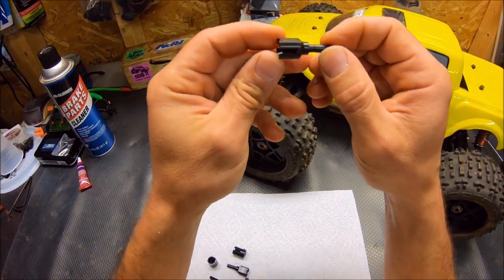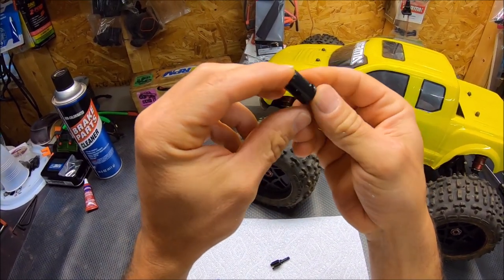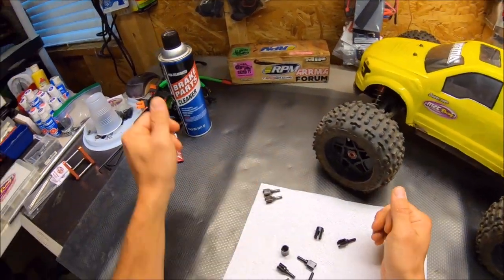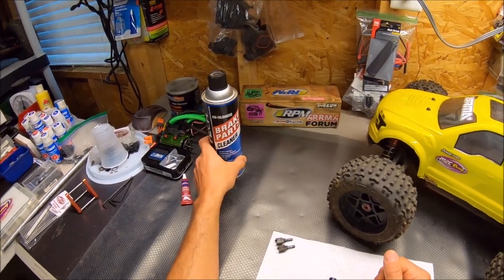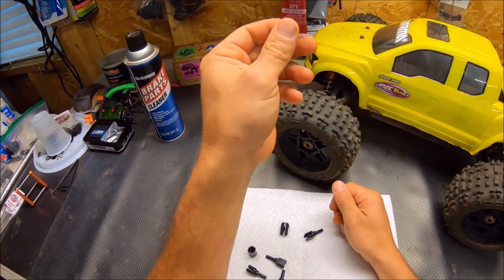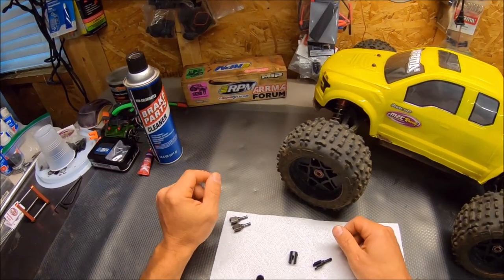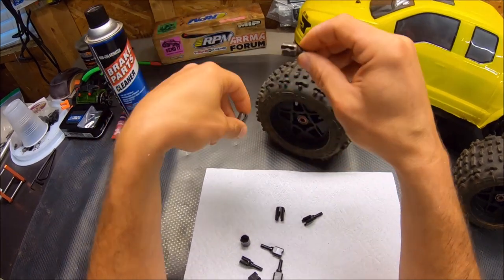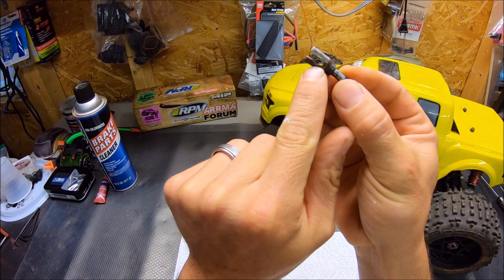These are just really beautiful drive cups. A quick recommendation: when you put these grub screws in, take it out and clean it really good with either standard brake cleaner or alcohol and really clean that grub screw. Then use red Loctite to lock that sucker in, just to make sure it doesn't come off the pinion shaft. This is an example of the stock ones — a better example of some of the bad ones. Over time they will pit out really bad, just like that.